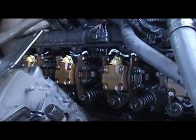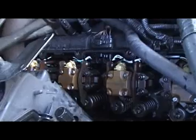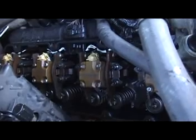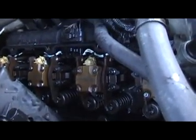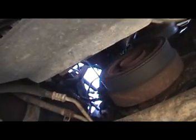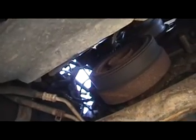Alright guys, as you can see, the injectors are in. So all four, they're already torqued in there. I'm going to put the torque specs in the description, and the ohms for the glow plugs. Anyways, we're going to go ahead and go underneath the truck, and we're going to turn it over by the crank. So let me go get my big ratchet, and we're going to turn this bad boy over until we don't have any more liquid. What you want to do is turn this over. Make sure you do it several times.